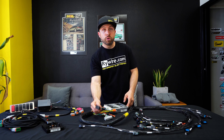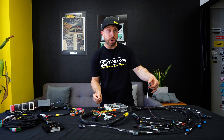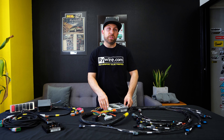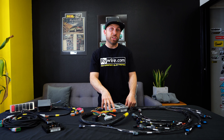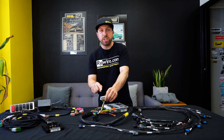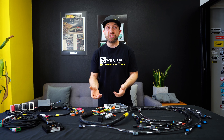With that, the O2 sensor for the wideband factory sensor is going to be on the engine harness as well as the primary O2 sensor. That changes things a lot, because on the other style wiring harness the E plug is on the body — but in this case, the E plug is actually on the engine harness. So the chassis interfacing adapter plug is going to be wired more similar to a B-series harness.